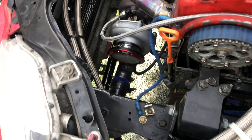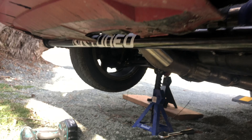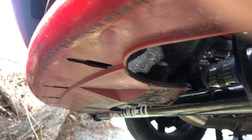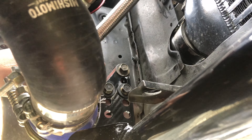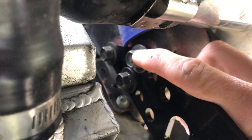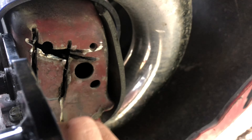That's the '96 Honda Civic hatchback right here. We're going to be doing the install on the traction bar from K-Tuned. I already installed it off-camera and I'll tell you real quick what I had to do. Those bolts are 14mm on the backside, there's a 17mm nut. Those went in fine. I had to slide the radiator over just a little bit to get the tool in there. On this one right here when I tried to loosen it, the nut spun.